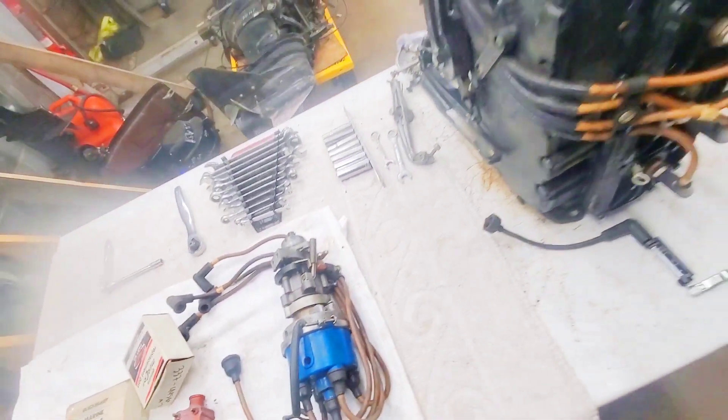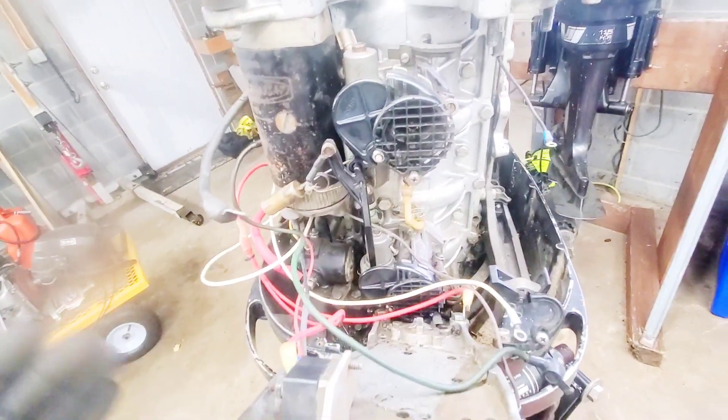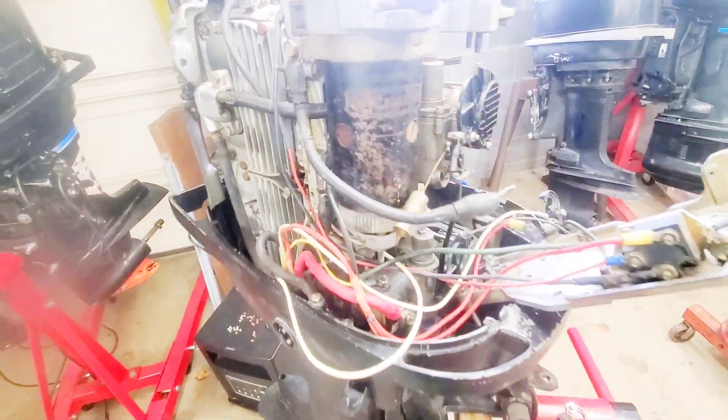What I'm going to do is go ahead and replace the entire ignition system with the traditional CDI — the 8 with the straight distributor and everything like that. The whole engine has been rewired, so I'm going to have to rebuild the carbs and redo the fuel lines, because they're already cracking and seeing better days. But the block is definitely worth the hunt, so that's what we're working on.